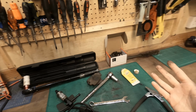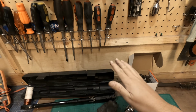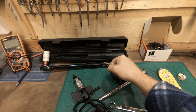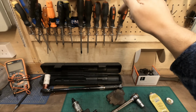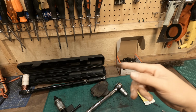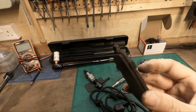When you're ready to put it back into normal operating mode, basically get in the car, ignition on, no engine, just ignition, push down the accelerator pedal, but this time the brake button itself, pull it up, don't push it down, pull it up. And while holding that up and the accelerator pedal down, ignition on and the ignition back off, and you'll hear the whining sound again as the pistons come back out. Once that whining sound stops, it should sit out of maintenance mode on your dash, and then you should be good to go. The brake pads have been replaced.